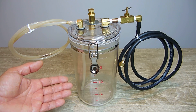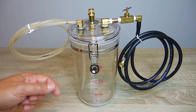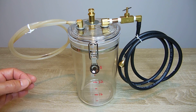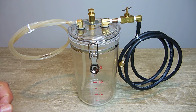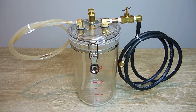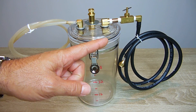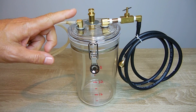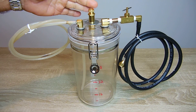You don't need 29 or 30 inches of mercury in order to suck the oil from an engine into this container. 15 inches of mercury is more than sufficient. And if you set it at 15 inches of mercury using this vacuum relief valve, you're going to eliminate any chance of this container collapsing. You can see right over here what happens if vacuum becomes too much inside a container — and that is exactly what you don't want to see happen. This valve will prevent that.